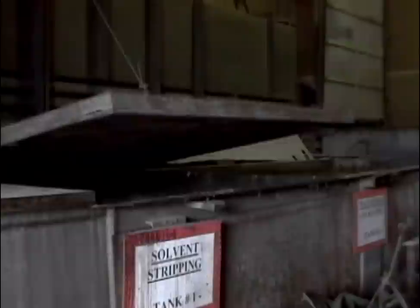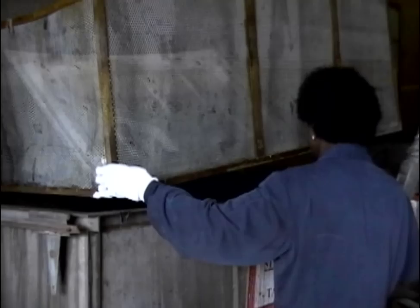The first step in the Techno Strip process is to strip the paint off the parts — in this case the GTO hood and trunk lid. They stay in the dip for 15 to 45 minutes depending on how much paint is on them. This organic-based solvent also removes leftover grease from seams. When removed from the stripping tank, the pieces are riddled with loosened paint and organic residue. A high-pressure wash removes all the residue and paint chips. The piece is then dipped into a light acid solution — 10% acid — which removes rust without damaging the metal, leftover bodywork, and oxidization. Another high-pressure rinse removes any leftover rust debris and traces of acid.